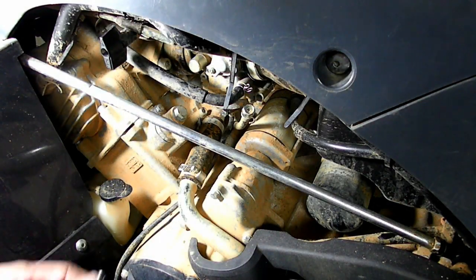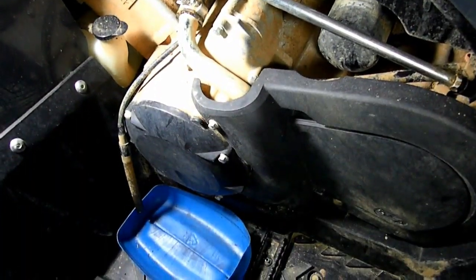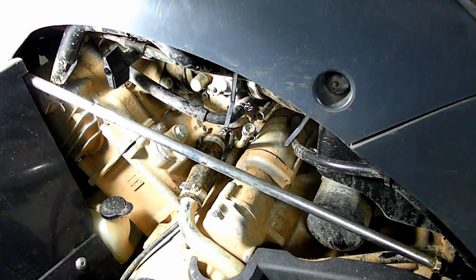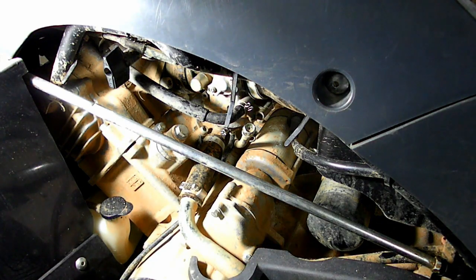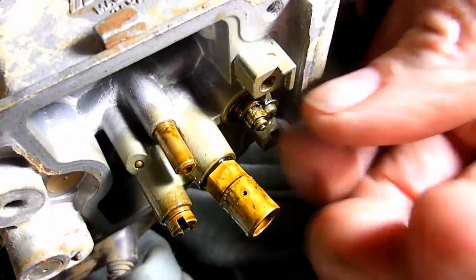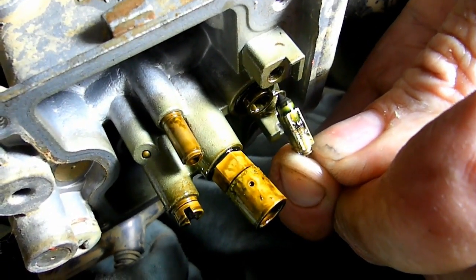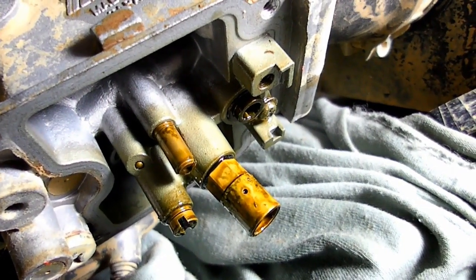I just filled the fuel in the tank and I opened up the drain, and look — nothing is coming out. What I suspect is going on is we have a stuck needle into the seat in the carb. We're going to have to take that off and take a look. Here's a lesson for all you people out there: drain the gas or put Sta-Bil in. Look at this needle — wow, that should fall out of there. Look at all the gum on that. Alright, clean it up and we should be in business after that. Hopefully.